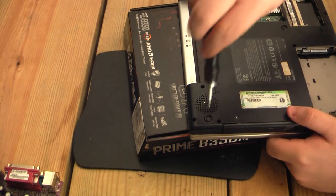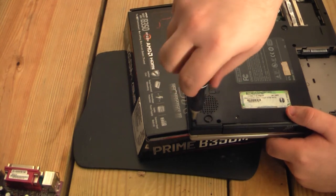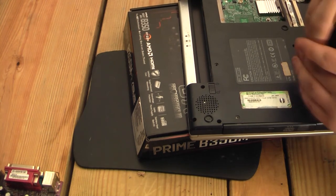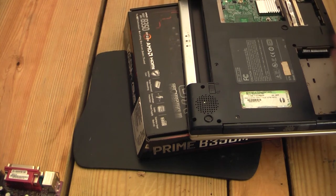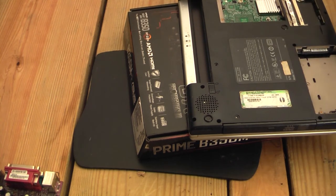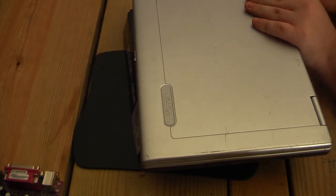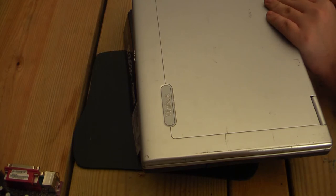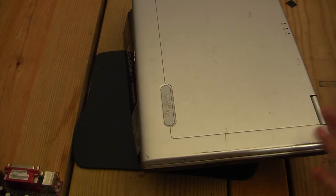Looking around for any screws I've missed. A couple screws under the hard drive area. They're loose already. Well, and now the last screws I could think of are either under the keyboard or where the keyboard was, on the hinge covers, and on the back thing holding the hinges in. I am unsure what all is needed to take out the thing, so we'll keep the screws separate.